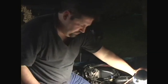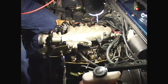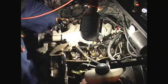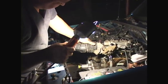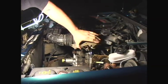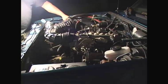All right, anyway, here's the front end of the engine. We're going to start it up without the valve covers on, as you can see, so we can watch the valve train and make sure it's all pumping oil. The oil you see in it right now is probably mainly from us pouring oil in it when we set it up. Some might be from cranking it over. We put the air breathing tube on so it can suck air through the mass airflow sensor. We have no throttle hooked up, so you can't control the throttle. We have the valve covers off, everything's in place, the ignition's hooked up. Hopefully I've got it just right about top dead center.